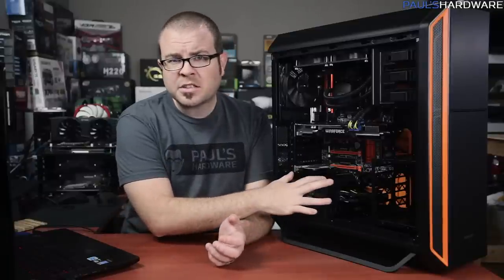Everything else went very smoothly, I'm happy to say, and after some work getting all the parts in place, wrangling the cables, I had the finished build that you now see before you. I'm going to focus on the Straight Power 10 700 watt power supply again for just a moment. This guy got the job done. I like 80 Plus Gold units for the efficiency at a lower price than you often pay for the premium that you have to pay for Platinum units. 700 watts gives some good headroom, and you can even handle two-way GPU configurations with this power supply, depending on the graphics card, of course.